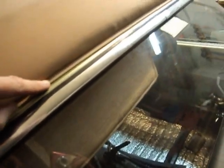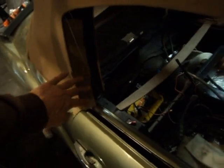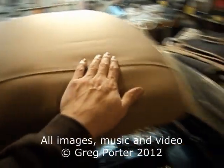There's my finish stapling — I'm going to put the top up and we'll take a look at what that looks like. That's what you want: that seam to lay down right on top of the windshield frame. The only thing we have left is the corners — you can see how they're kind of gappy. We'll put on the side tension cables and that'll take these wrinkles out and tighten up the corners. We'll come back in, glue it down and secure it properly, then do all the trim pieces. At this stage you should be able to bounce a quarter off this roof — it was very difficult to close, I had to lay my entire body weight on it. Over time it will stretch a little, but everything is very tight through here. Just want it tight — that's it.